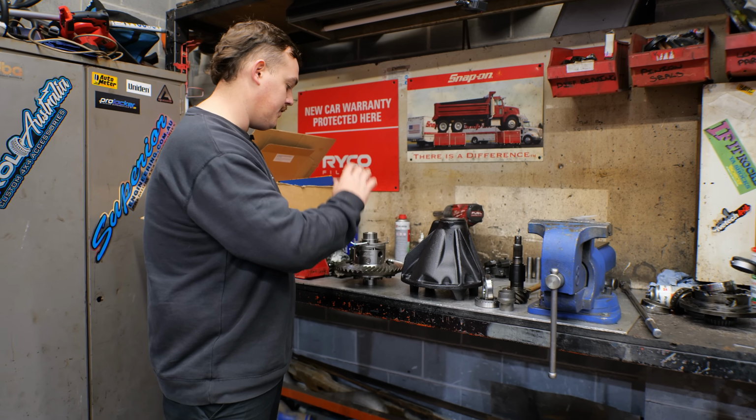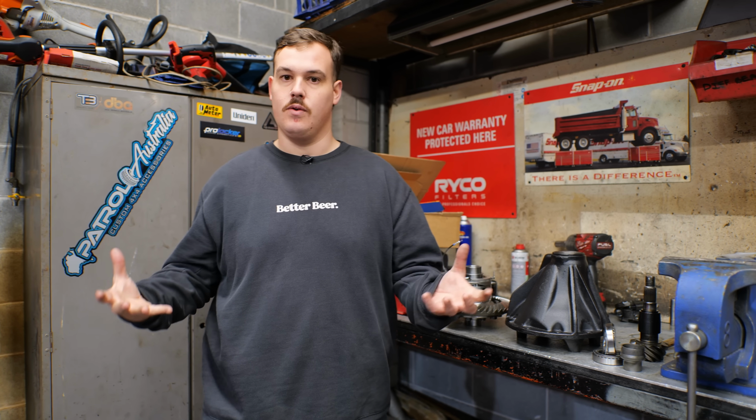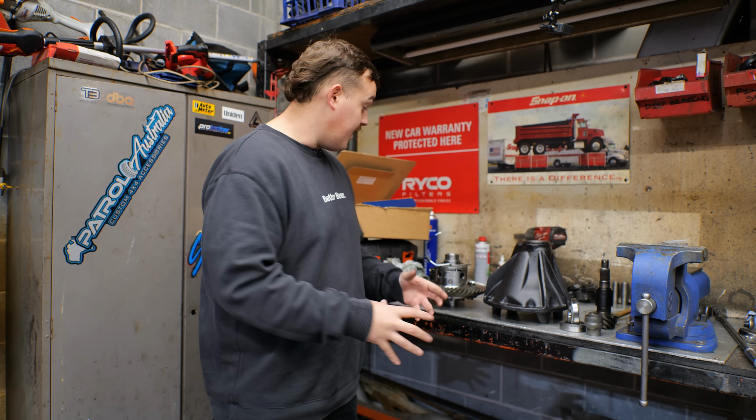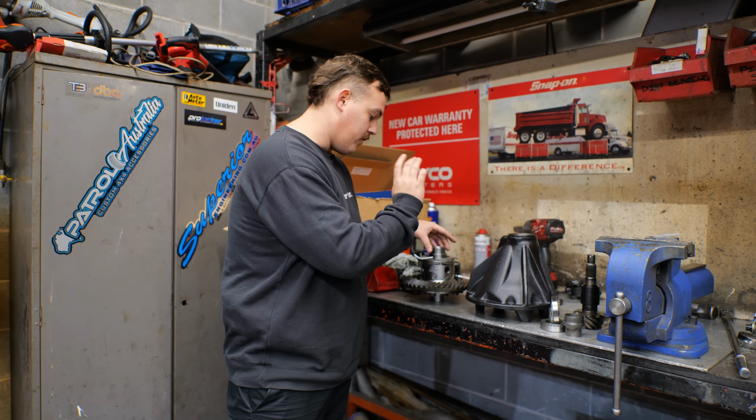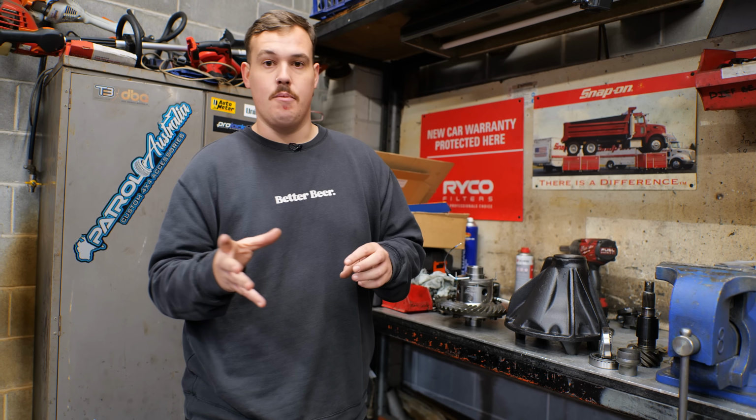These have got the nitro forge gears, so they're super strong, and obviously we're going to be able to lock both those wheels in the back for skids, I mean, driving off-road and that sort of thing. So that's going to be good. That's installed. We've got a genuine 4.1 gear set here, which is in really good condition. I think that's very important as well.